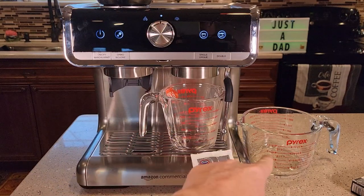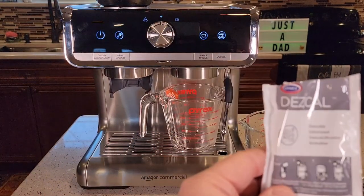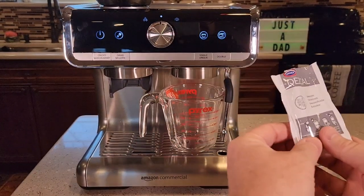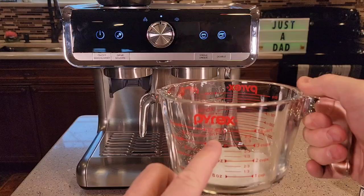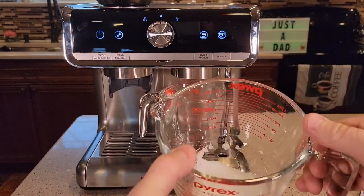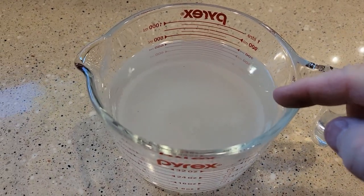So you're going to need two containers. One has 32 ounces — we're going to mix the descaler with that. Take the packet and put it in the container. Now we need to put 32 ounces of water with this and dissolve it. We'll need to stir it up a little bit to get it nice and dissolved. Here's what it looks like when it's all dissolved.